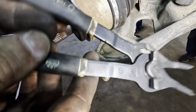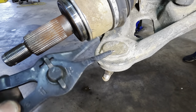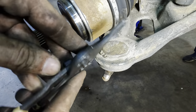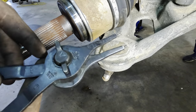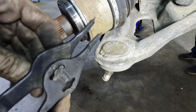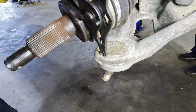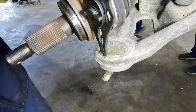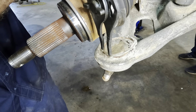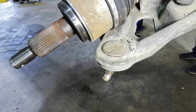Okay, snap ring pliers coming in. These are actually reversible. You can either pull the snap ring or you switch positions, then it will push. So they're good for inside snap rings and outside snap rings. Fun fact. Anyway, we get that guy down the hole, give it a squeeze, safety squints, and there is our snap ring unit.